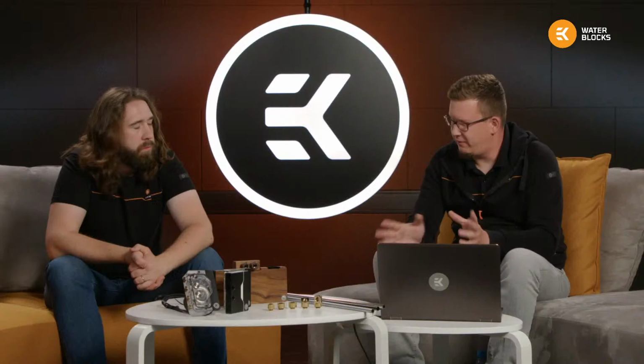We will take a final question and then wrap it up slowly. It's a question about static pressure on the new fans versus the old fans. I think the static pressure figures will be roughly the same. The main deal will be the new magnetic levitation motor which will be implemented in the fans, but I believe we will also tweak the blades a bit, right? Yeah, the hub size was actually tweaked and increased slightly, and that may help static pressure